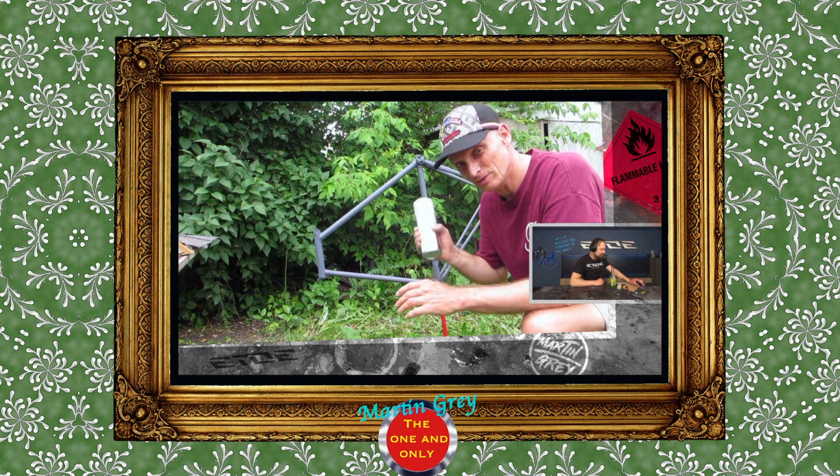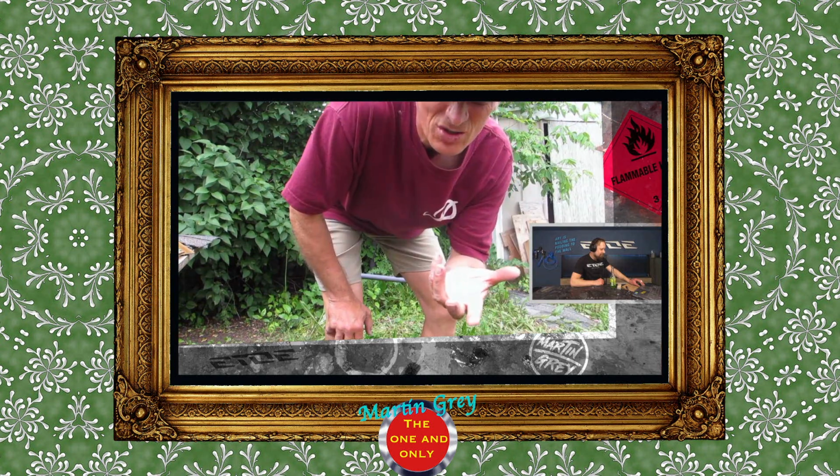Put a second coat on, and that should be good enough. It's not good to breathe. If you use spray can primers, they are very thin, not like professional primers, so I recommend 2 to 3 layers as a minimum, so you have a good surface, and you need a lot of material because you'll have to sand it down a little bit if you want to flatten it. So apply maybe 2 to 3 layers of primer. That makes sense. Don't skimp on primer.